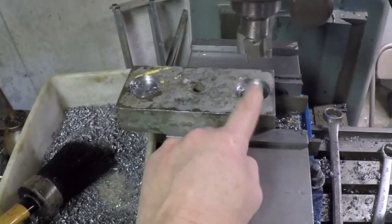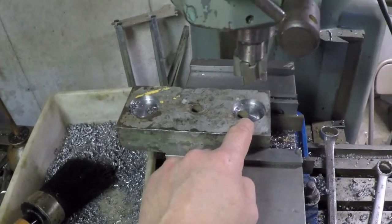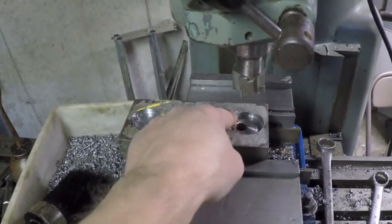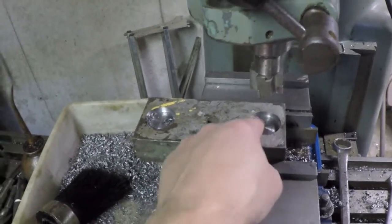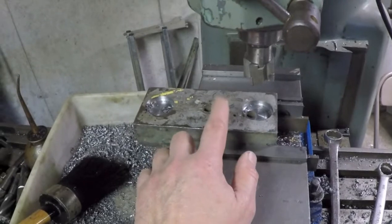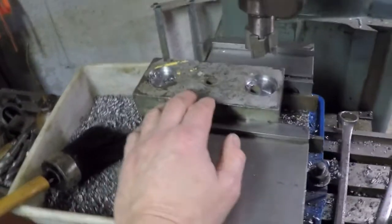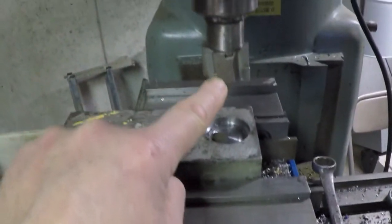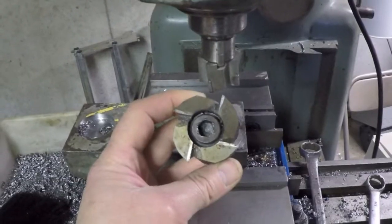So the long and the short of it is — how do I cut this recess? Well, obviously there's more than one way to skin a cat. I thought about using an end mill mounted on a rotary table and plowing out a ring-shaped groove to make the OD, then making some passes to cut out the metal in the middle. But I thought about how I could do it if I had it mounted another way, and that brings us to the tip: the use of two-flute end mills. What I ended up finding was a shell mill — I've still got it mounted here — which is exactly the diameter of the recess I wanted to cut.